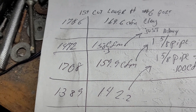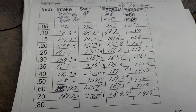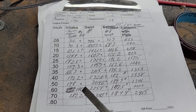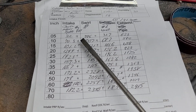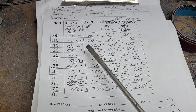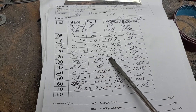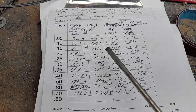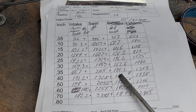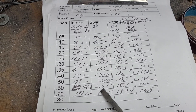We went up to 17.08 as far as swirling — our swirl is much better. Take a look at how incredibly close a lot of these flows are from the upper plenum to the lower plenum. Those are all really close. Even at 0.25, pretty close. Starting to gain on the deeper plenum. Now we start making big gains on the deeper plenum — up nine. And then it starts to even out; it's not too far out of whack.